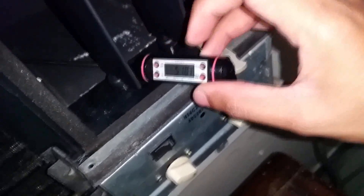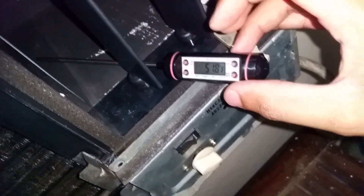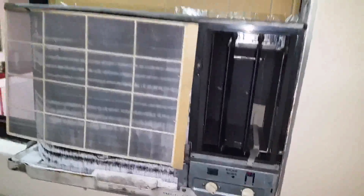At this point I was not sure what the reason was, so I looked it up online. There are some other reasons — one is if you have dirt in your evaporator coil, that will also cause frozen evaporator coils. But I had serviced this AC myself and cleaned it thoroughly, so I knew there was no dirt in my evaporator coils.